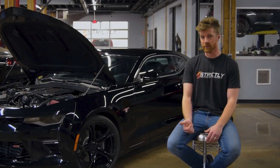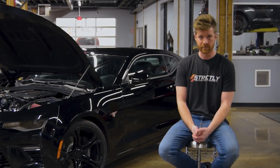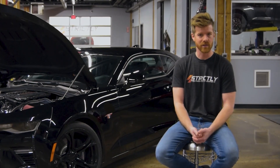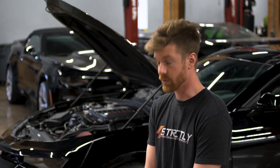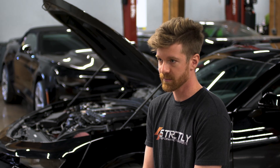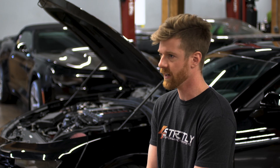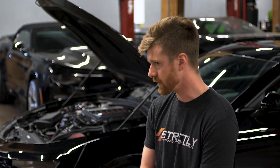This is probably one of the most unique things about this car. It is running on full flex fuel, DI only — no meth injection, no port injection. To achieve that, we have a quad in-tank setup so that we never drop any pressure on the low side. It holds a consistent 75 PSI throughout the entire pull.